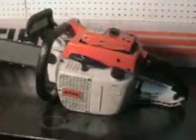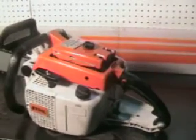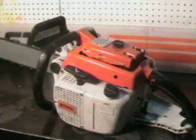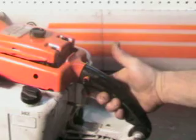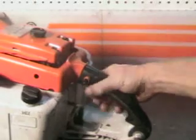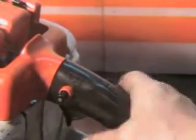I'm going to take a close-up of some of the features this saw has. Kill switch right here. Choke's over here. Does have the operator presence lever right here — it won't trigger up unless you have your hand in place. Does have a throttle lock. Squeeze both of these and push that button in — that locks the throttle about quarter so you can start this a little easier.